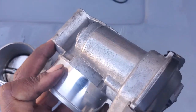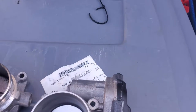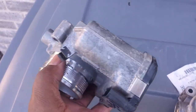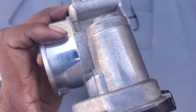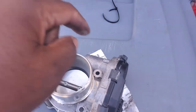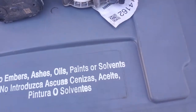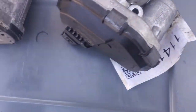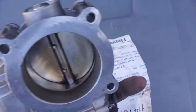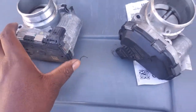This new one is a lot cleaner — I tried my hand at polishing it, all by hand. I did 3,000, 5,000, and 10,000 grit. Just for reference, here's the unpolished one versus the polished one — pretty cool, it does work. The stock one I did nothing to. Let's see if there's anything we need to transfer over from the stock body to the new throttle body — I don't think so, though I see this clip here but I may not be using that anymore.